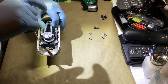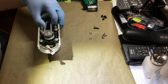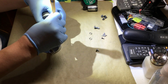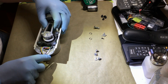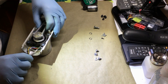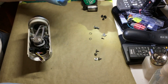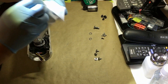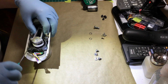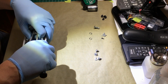Four screws get the motor and motor mount out of the casing, and there are rubber grommets around each screw for shock absorption. There's a lot of graphite, so with the four screws out you'll have to slightly pry the mount up off the post because the grommets keep it pretty snug.